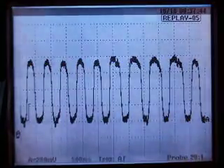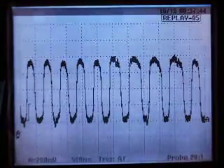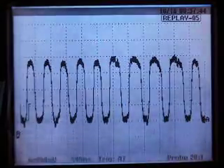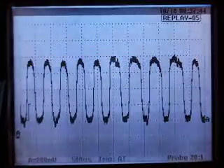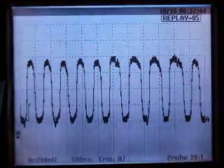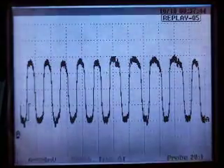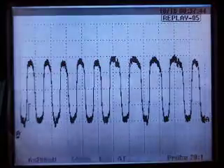It's critical to have a very good connection on an oxygen sensor because the signal is not very strong, so a bad connection can bring all kinds of interference when you try to get a good picture of it. This is actually a very good picture, and you'll find working on vehicles that sometimes you have to work pretty hard to get a good picture, especially if you're getting interference from electromagnetic fields that are pulsing around where you're trying to get a pattern. You can play around with different kinds of frequency rejects, which helps change the bandwidth that the scope is going to look at.